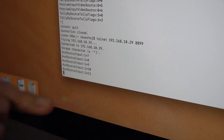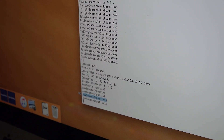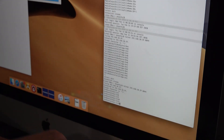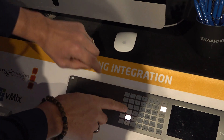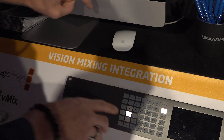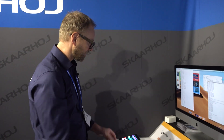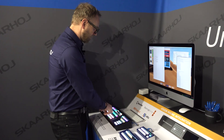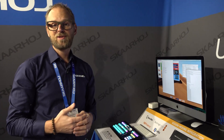Now I am pressing another input. All you need to do is replicate this — basically copy this command. I copy it and paste it in, and notice on my ATEM switcher, which currently has input source 11, as I press Enter I will see this change to 10. The learning mode essentially means that any change of state that happens on the ATEM switcher will be exposed to you on the TCP Link Telnet interface, making it super easy to identify the things you want to do. With all these controllers, you can execute commands on the ATEM switcher or with the ATEM software and you will see it replicated here on the ATEM TCP Link console.